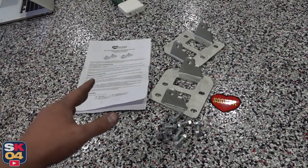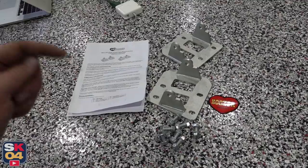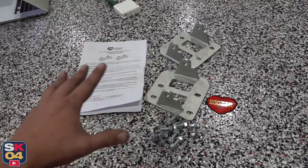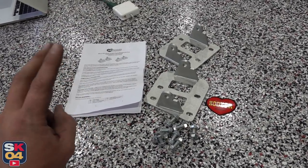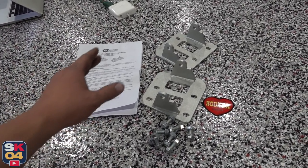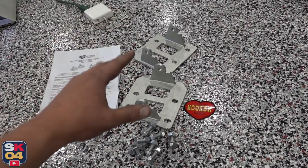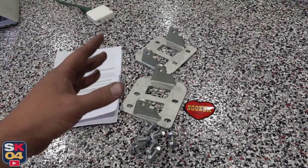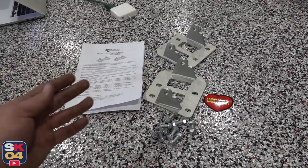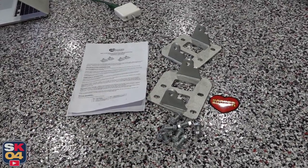When it comes to swapping in the new powertrain, I'm actually going to be using a complete LS swap system from Hooker Blackheart. I've got some links to parts I'm using down in the description below. In theory, all of this stuff is supposed to go together to make it almost bolt-in, or at least with minimal modifications. They have two different styles of LS motor mount conversion brackets — these are the forward mounts, which should require less modifications to the transmission tunnel when using the 4L80 transmission that I have. So let's get these mounted and then we'll talk about the transmission crossmember.